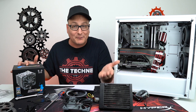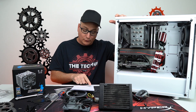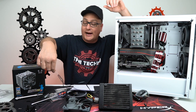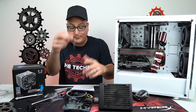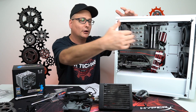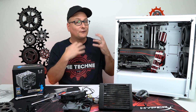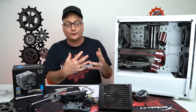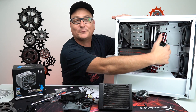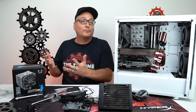That was at the exact same fan settings in BIOS — I didn't tweak anything. The fan on the cooler was running at 750 RPM, so it wasn't cranked up and was not loud by any means. The cool thing is there's a slot on the back and they give you extra brackets, so you can actually attach another fan for a push-pull configuration and get even better results. That really shocked me — the great results at such low noise. Switching from the AIO also eliminated one fan and actually freed up some space.